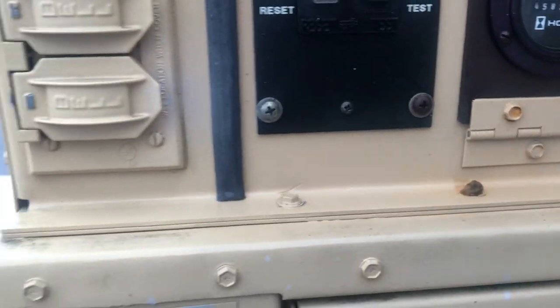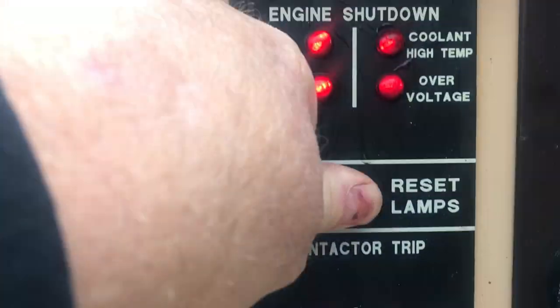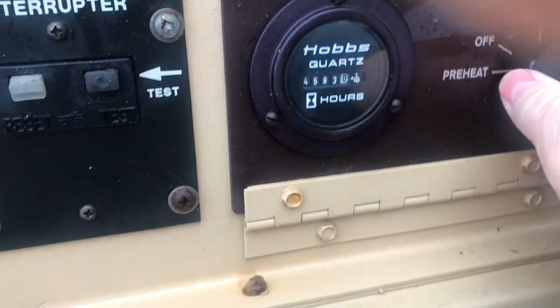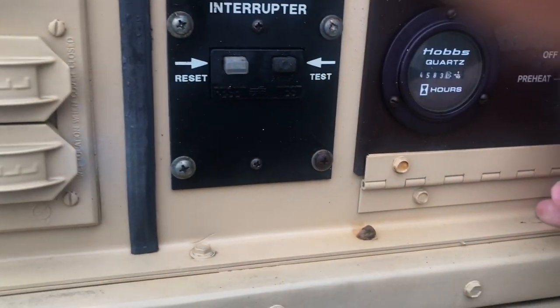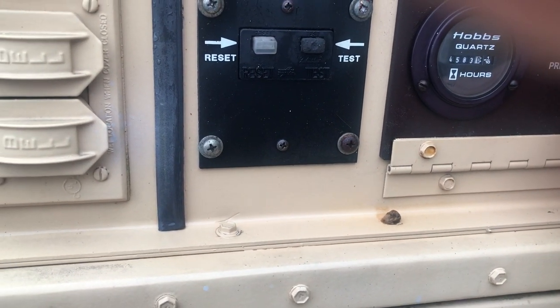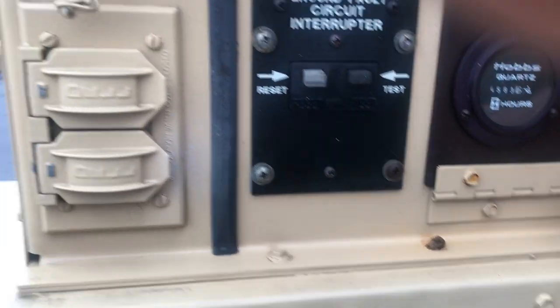Let's give her a start. We're gonna turn this to prime and run — you can hear the fuel pump running. This is the test to show you everything's working. Then we're gonna turn this to preheat and preheat it for a few seconds. I don't know if you heard it clicking — I haven't started this at all, it's been two days.